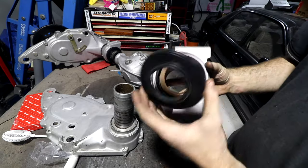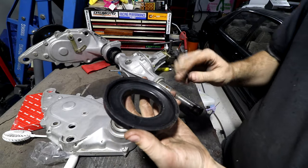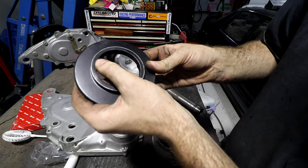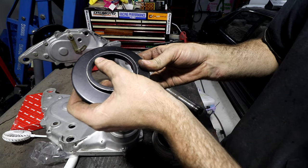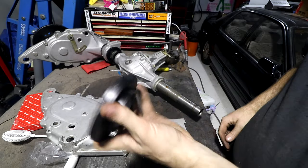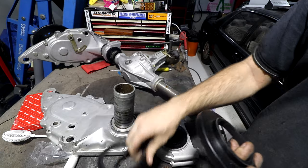This is where the seal thing kind of comes apart a little bit. On the end of this are these seals. These, unfortunately, are not standard size seals, as you can see. It's a really weird shape. It does actually have 60.5, 105, 113, 18. It's got a size on it like it's a seal, but this is a Honda-specific thing. Same for this big giant one.